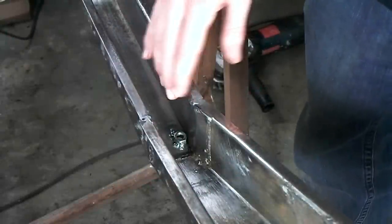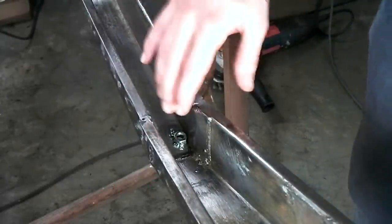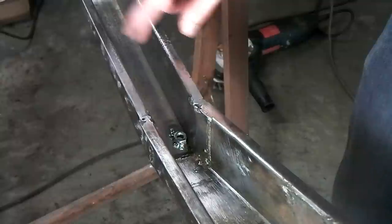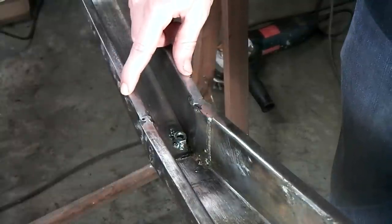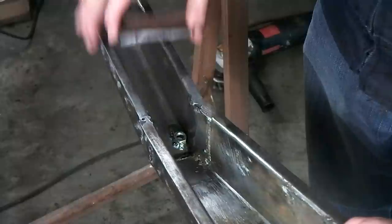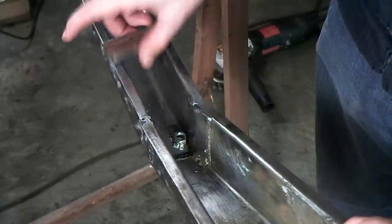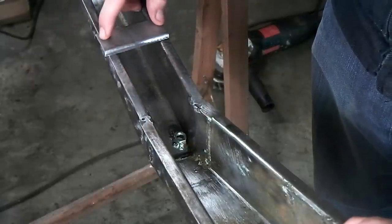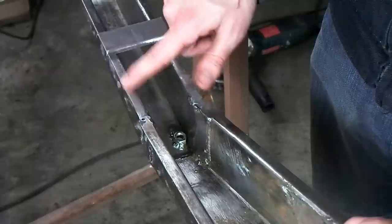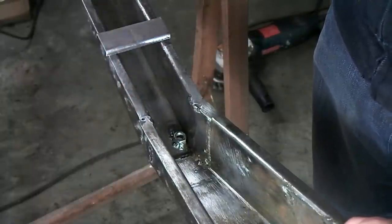As you can see, I've welded the nuts on the back of the chassis and I've cleaned off most of the rust on the inside of the chassis. I've done this because once the plate is welded back on it's very hard to reach this spot. Now before I weld this plate back on, I will spray these surfaces and the back of the contact points of the strengthening plate with zinc spray, because the areas in between the plates have to be painted before it's welded.